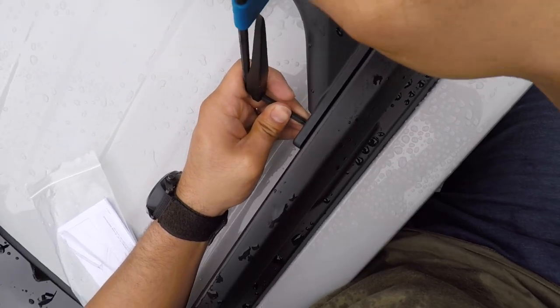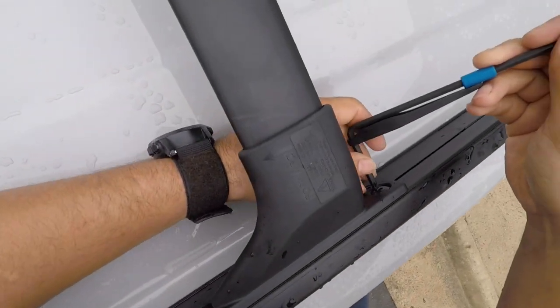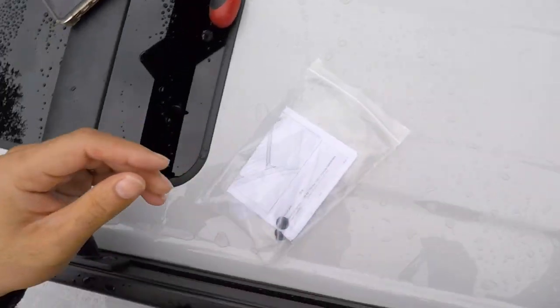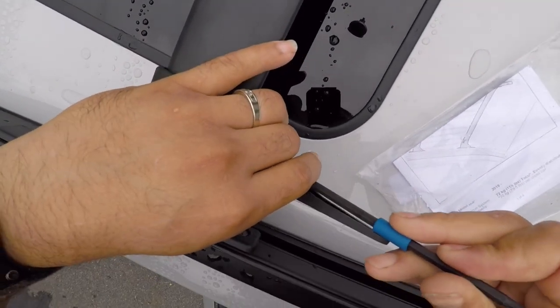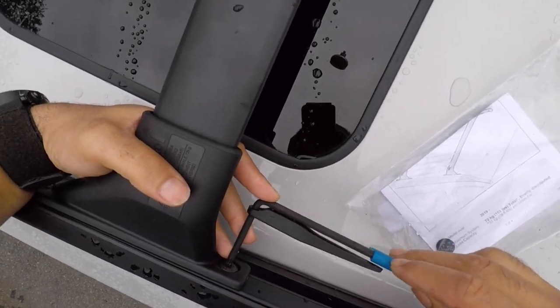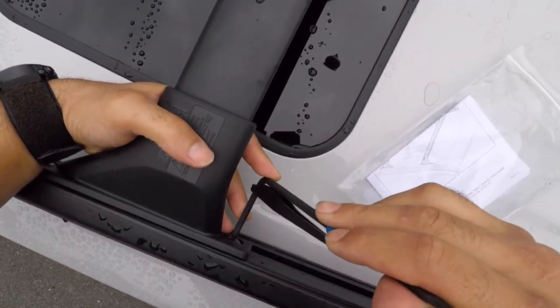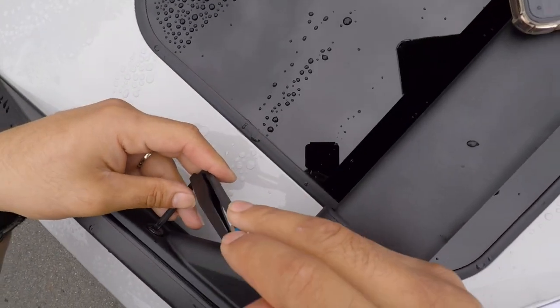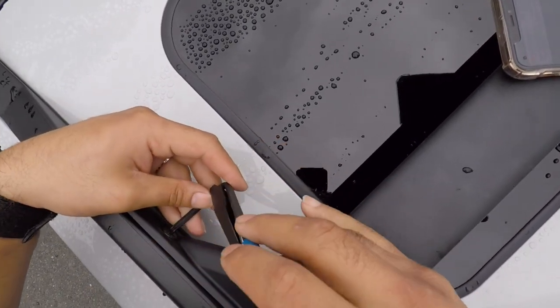What I'm doing here is torquing it. Make sure you look at that little indicator and go to 8 newton-meters on all sides. Now there are some screws on the bottom of these bars that need to get tight also — make sure you do that. I didn't show it on the video, but I did it because they also require a smaller Torx bit.